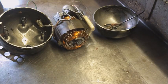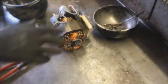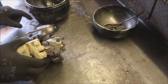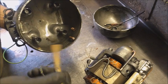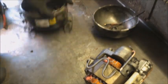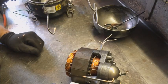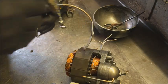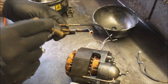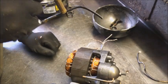Just lift off. We'll just snip the wires there. Now that's the pump out. On the inside you want to have the mounting springs and two tiny stubs of copper, which we'll cut out. The bypass tube, although copper coloured, is magnetic. And the stubs that we cut off can either be copper or copper adjoined to iron tubing.